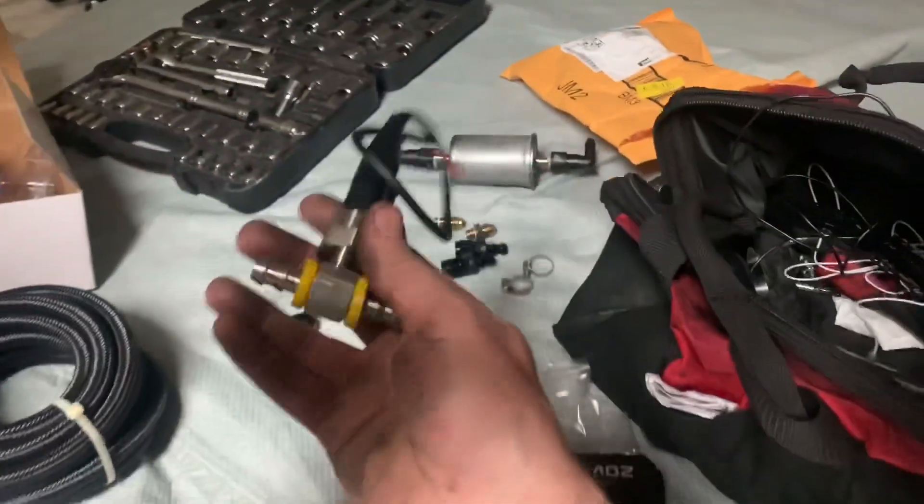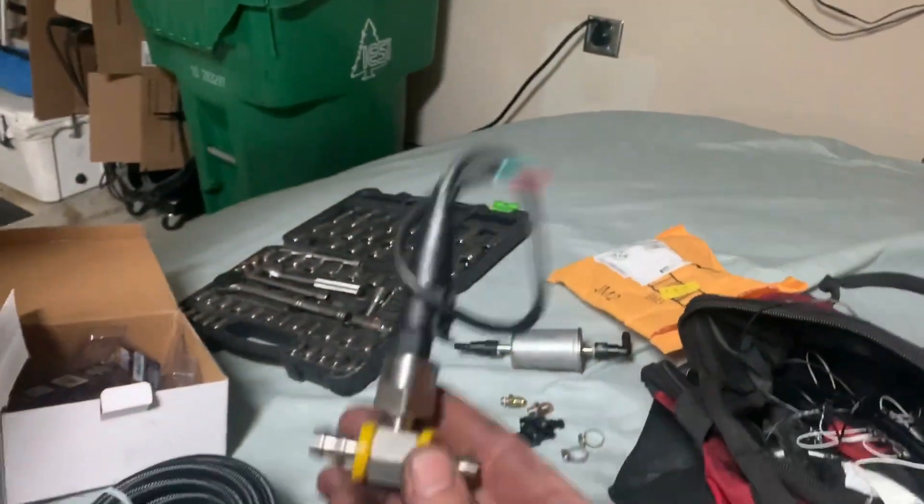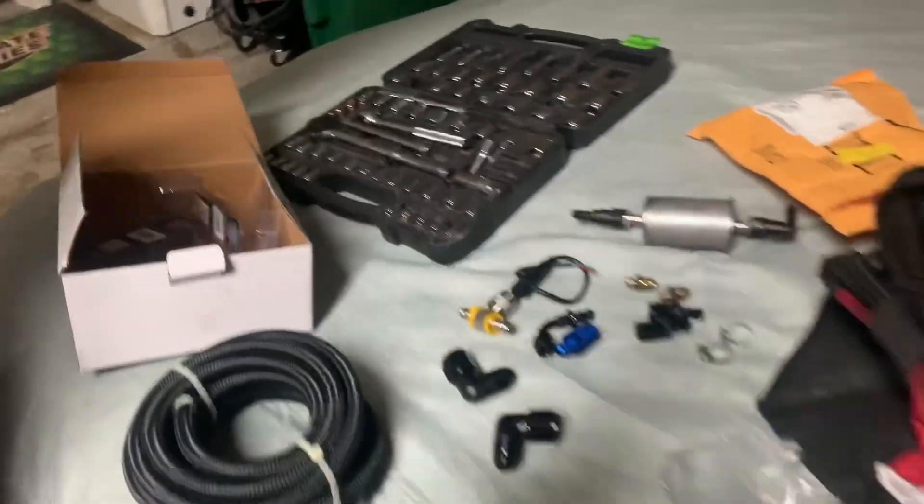I don't think this engine is going to outrun a three-eighths system as long as we have the right pump in it — and that's still to be determined, but we'll find out with our fuel pressure sensor. The sensor is going to talk to the MegaSquirt and all our data logs will have that information. We're a little unsure about whether we need a fuel dampener. Normally on a sequential multi-port system I'd say no, but this is batch fire so all the injectors hit at once, causing more pressure pulsation. We'll send it without one and see if anything shows up funny in the data logs.